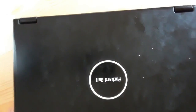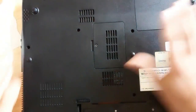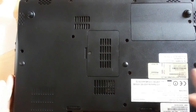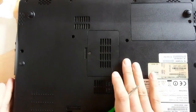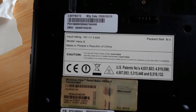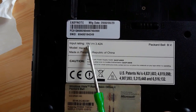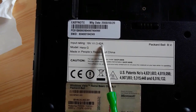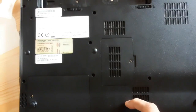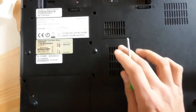Because if the adapter is bad, it's normal for the laptop not to turn on. Now we're going to disassemble this laptop to get to the motherboard, because the failed part is the motherboard. The laptop model is shown here — 19 volts, 3.42 amps input. We'll disassemble this door first — this is the RAM door.